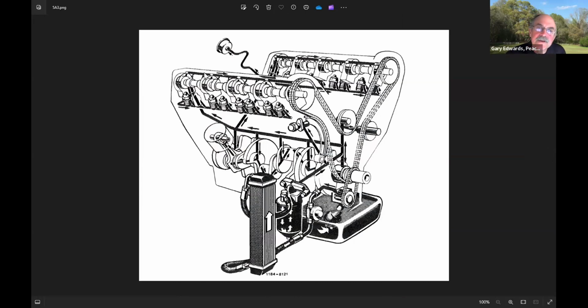Now, what can happen with these cars is that this tube can fall off. It just falls down into the valve cover, and suddenly your cam isn't getting any lubrication for any of the front bearings. You should hear something if that happens, and then hopefully you'll stop driving the car and get it investigated and repaired. If you ignore the problem, then the cam bearings will eat themselves. It'll probably break the cam towers. It's very likely it will break the timing chain, and valves will hit the pistons. And then again, you're in for a really expensive repair. If you do not know how old these little plastic pieces are in your cam oiler tube, you should just go in and change them.